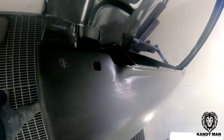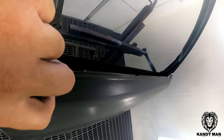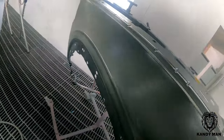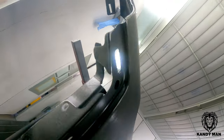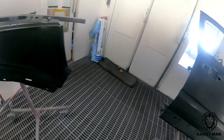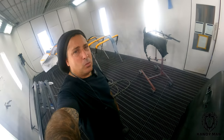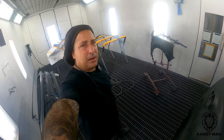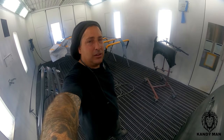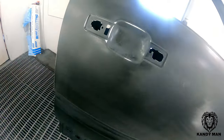Look at the flat panel on the top — if you're light with your paint like you would be on normal cars, you'll miss paint on these edges. Make sure you check over the edges and body lines carefully on a newer vehicle. See how this curves around in here — go around your edges no matter what, but take extra concern on something you haven't shot before. When I'm doing a new vehicle, I like to look at the actual parts that were on the vehicle to see how it all fits up so I don't miss anything.